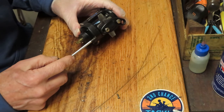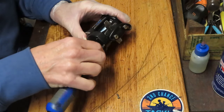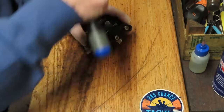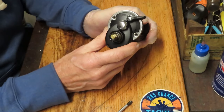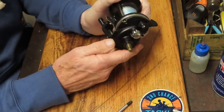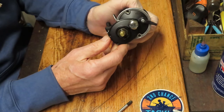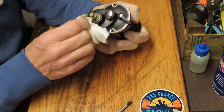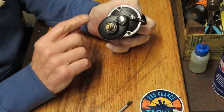These two sets of screws are very different — you're not going to confuse one for the other. But sometimes you'll notice that some of the screws are longer, shorter, wider, or thicker, and you want to pay attention to those. One of the best ways to do that is take pictures with your cell phone camera at various intersections where it's important. That'll help you in the reassembly process. All right, the screws are out — we should be able to remove this now.